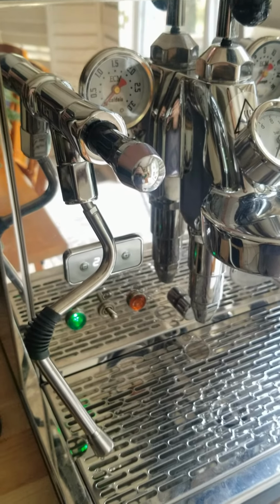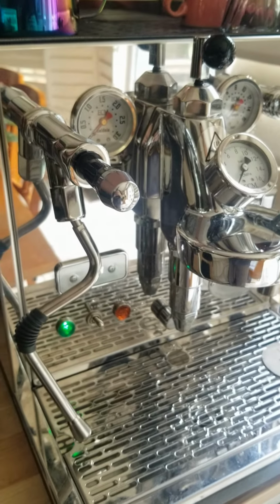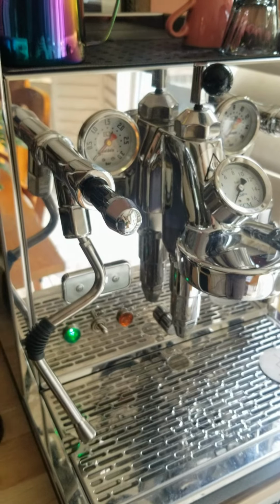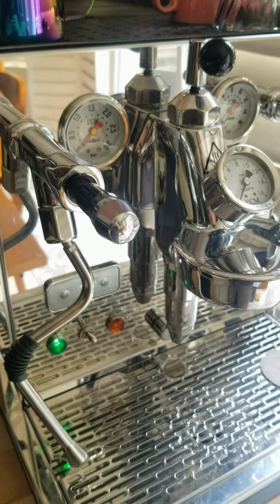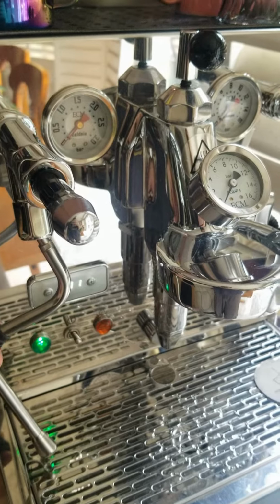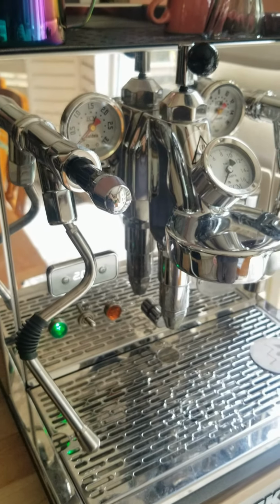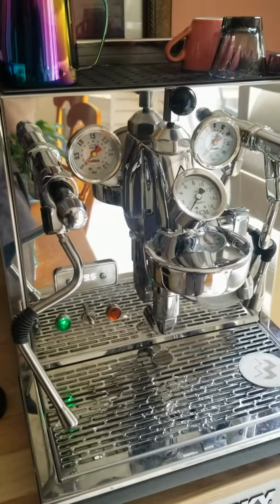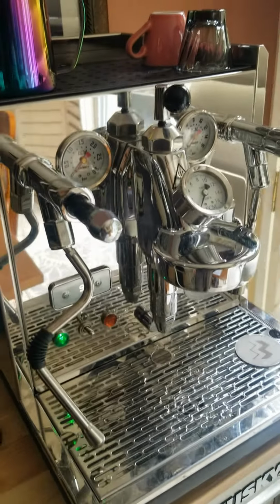If I get another machine like the Meticulous, where it's not a traditional boiler where it has water concentrating under high pressure, then I'd probably use Perfect Coffee Water, just because it has chlorides in it, and I think that tastes better, but it's corrosive to stainless steel boilers, so I didn't want to risk it in this one. I tried it once, and I really liked the taste, but worried about long-term use. I think ECM said it was okay. Of course, Perfect Coffee Water and the shop selling it said it's okay. But people that know boilers and espresso machine repair say not to do chlorides, especially with stainless steel.